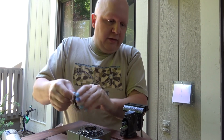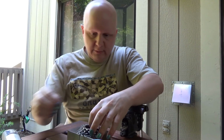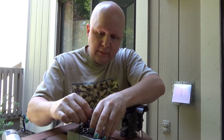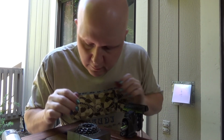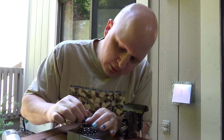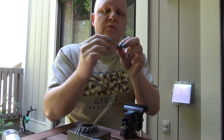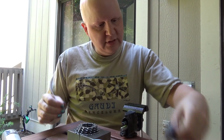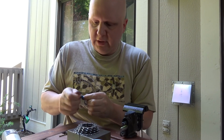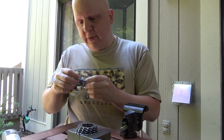So we're going to need 3 of these because we have 3 holes to fill, and we are going to need to mark them out for length. That's why I got my lovely 1-2-3 blocks out here. I'm going to try to snuggle it up in the corner here. I want to make sure I'm on the 1-2-3 block, and actually, that is super convenient. It is right where the coating ends. Let me double check that these coatings are all the same length. That'll actually save me marking them, which will be nice. I can just go onto the coating, and they look pretty similar, yeah.